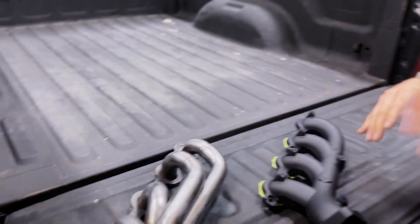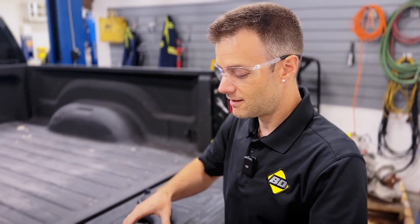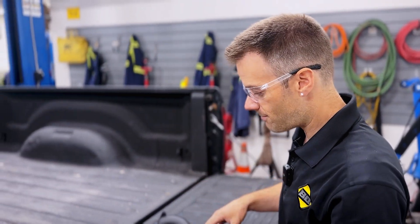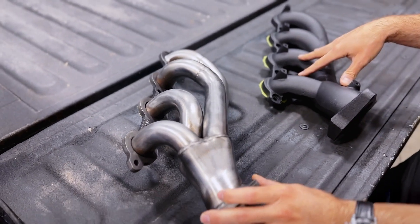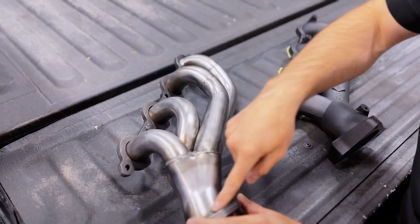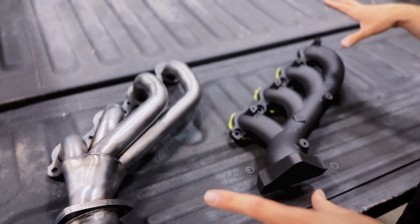Now, I don't want to completely bash headers — in a race application, like a drag truck or drag car, there are advantages to making long tube headers that flow properly for the motor and give you the best efficiency. But that's a different topic. We're talking about just direct drop-in, bolt-in, where I don't believe — and we can probably show — that this is not as good as just sticking with a cast manifold. So number one, as we just said, reliability. A cast manifold is going to be more reliable, especially when it comes to the welded joints. This header has joints everywhere, and the cast manifold has none. It's all fairly uniform in thickness and is going to heat and contract fairly evenly.